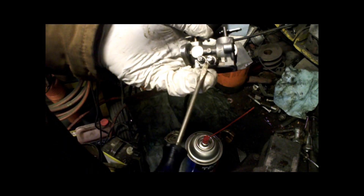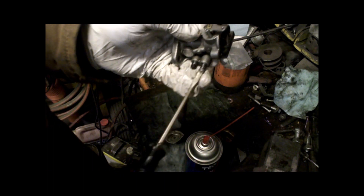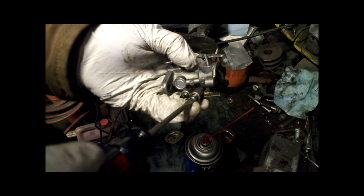This one's your idle. That one's your high — or they call them low and high. And you see a little H right there. A lot of times they have a little L mark somewhere as well. Low and high. So this one will be pretty fast. This one's for low. These things don't really idle, but they still need an idle circuit to run better — they just run smoother with an idle circuit.